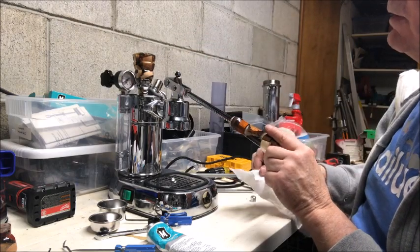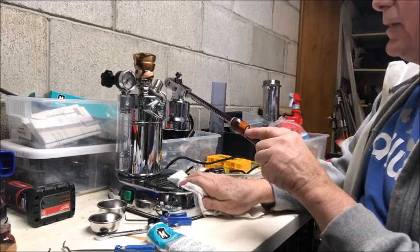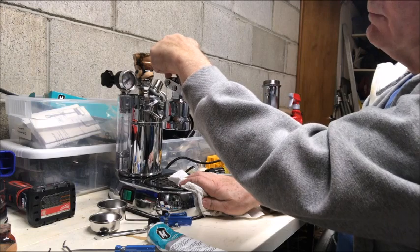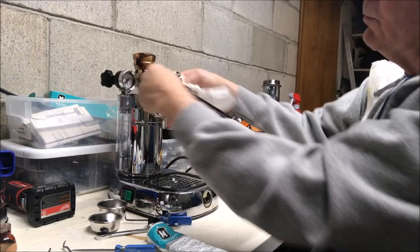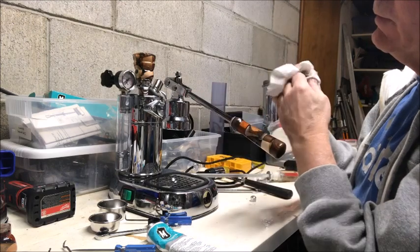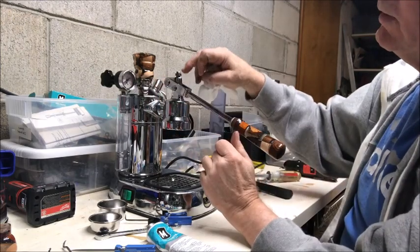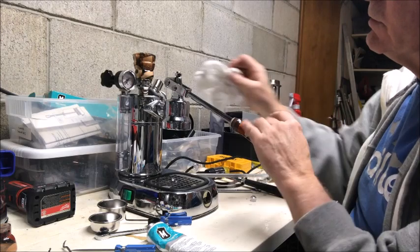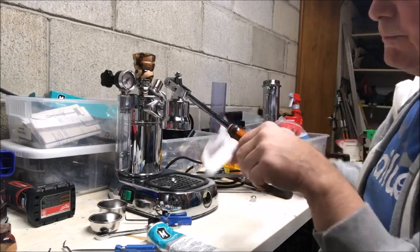Those two little shims on each side of the front shaft pin actually took care of it. I'm not going to show you how to do the piston throw again - that's in another video. Look at the difference now - I'm holding down the base and this doesn't move at all. Tighten the back with a plastic mallet, nice and snug, and then I prefer to use the shims. I applied two small washers - I can put the size in the comments - on each side of these pins, and it just took out all the play. That's it, thank you.